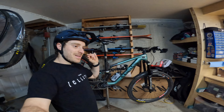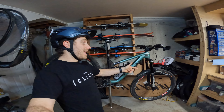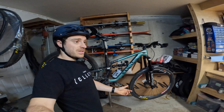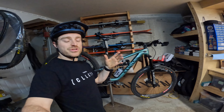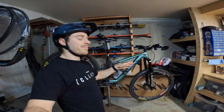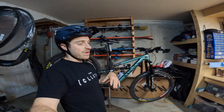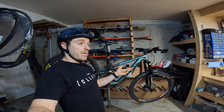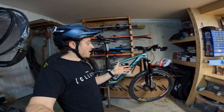Back home in Squamish, I raced this weekend on the coil because I think it suits my style — I need to be calmed down. I get enough pop and things out of things. Now I've actually gone to a 170mm on the fork, which I did for the Pemberton last weekend, which was steep and fast, and to get ready for the Strive, which has more travel. I wanted to get a head start on setting up a 170mm fork and not just go from a 160 and have to figure out a new bike plus the travel. So I went to a 170 air shaft on that.